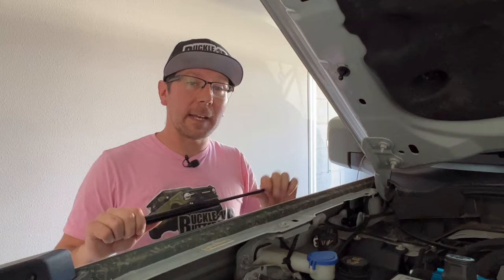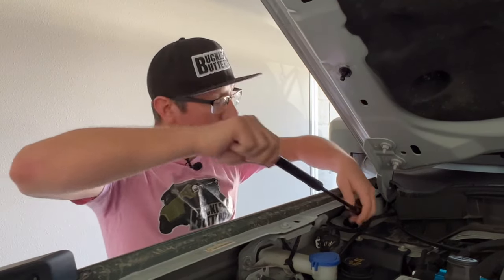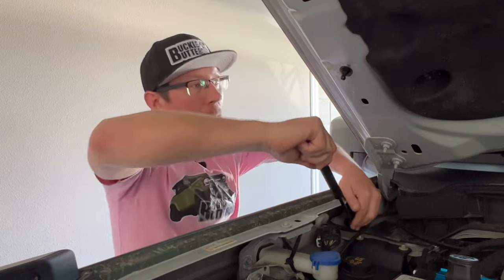To make sure the bracket is on the correct side — once it is placed in the vehicle, the bracket is going to face forward with the ball end facing the centerline of the vehicle. Finally, with all of our hardware tight, locate the strut and with the rod end facing down, just press the tips over top the ball ends.